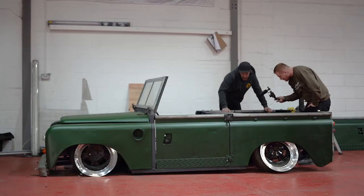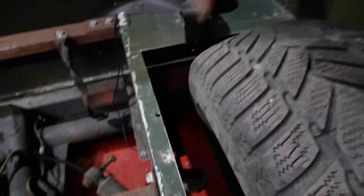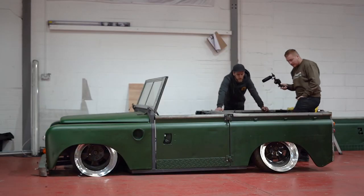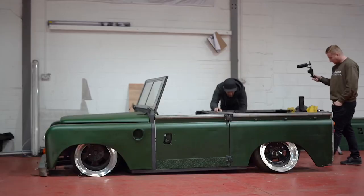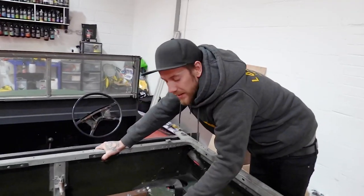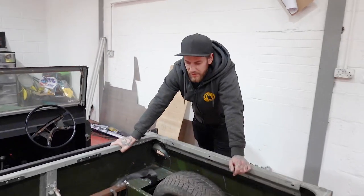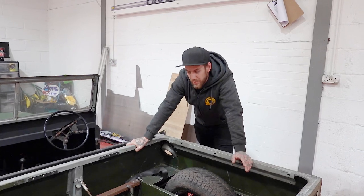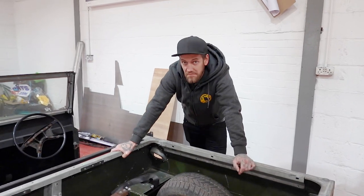We have got the rear spring plates on now. The new spring plates have come - they have a 4-inch drop plate. So I think what we're going to do now is mount the rear bags and everything. I think I'm going to run basically a back half on it - I'll come from here up to this back cross member, which is obviously tied in with the gearbox. I'll go round, build the bag mounts off of that. That'll be a separate rear end, so it won't be attached to any of this, and this can come off if it needs to. That's something we're going to try and get a bit more detail on, make it a bit more informative rather than just us titting around.